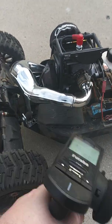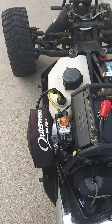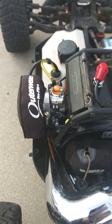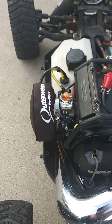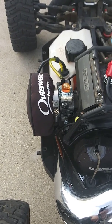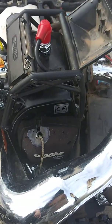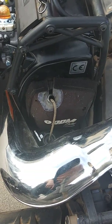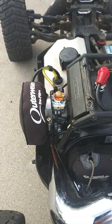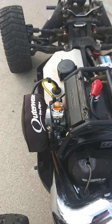I got the DDM dominator pipe. It came with a 990 carb, but that one I've been using for a while and I think something got stuck — it just would not start. I put a 668 on there just temporarily. I'm just breaking the engine in. The pull starts going, you can see the stupid thing is just twitching, simply popping around. I hooked the 668 up and it started in a second, so my 990 carb is messed up.